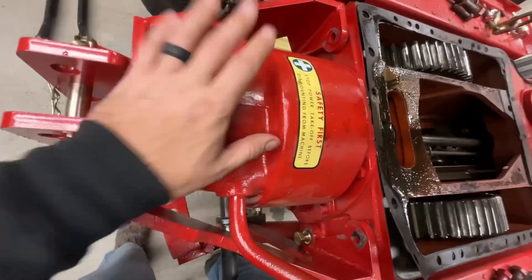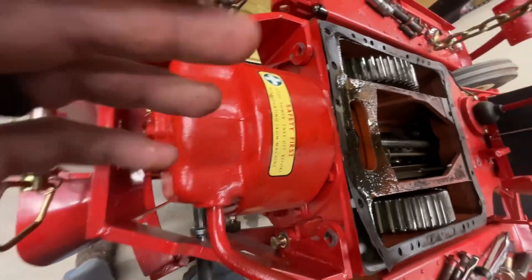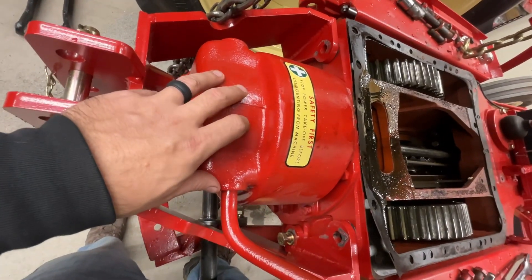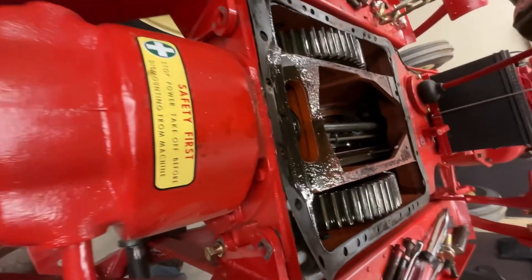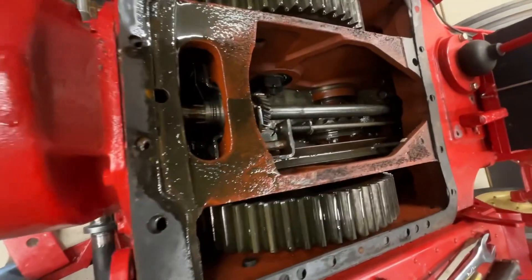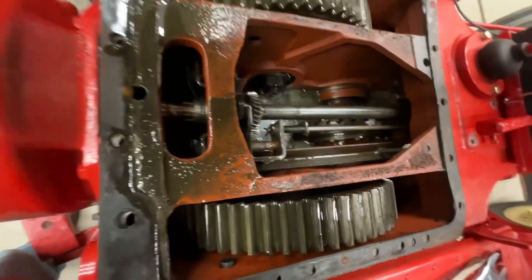This inner shaft goes through the inside of all that other stuff, so it's always running — completely coupled to the engine, not clutched through power transmission. There is gear reduction in it, since your power takeoff only spins at like 500–600 RPM. So it has a clutch pack and gear reduction that drops the speed and pumps up the torque. You can actually see it live on camera.